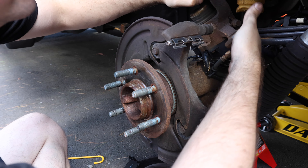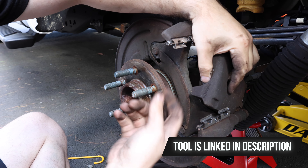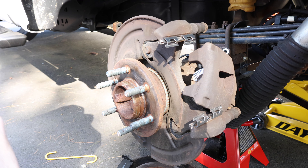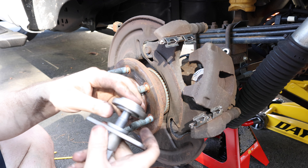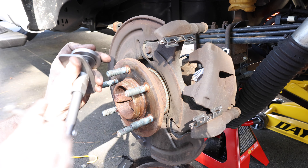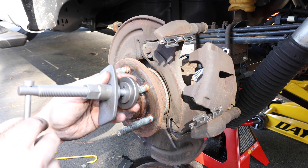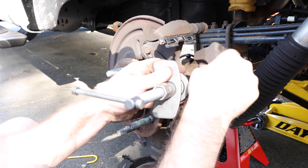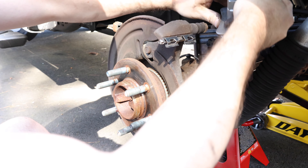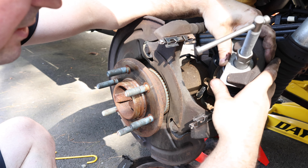It's a good idea to clean these up and scratch off any rust that might be on the mating surface. You really want to make sure these are sitting flat before you put the brake pads in. If you want to make sure that this comes off easier next time, you can put anti-seize on this, or you can put anti-seize on the back of the rotor before you put it on. Mine came off so easy and it's probably going to change in the same time frame, so I'm not going to bother doing that.